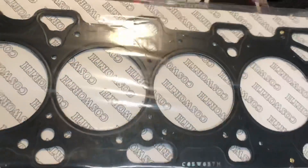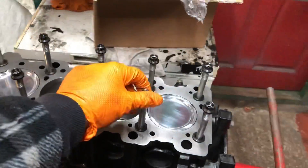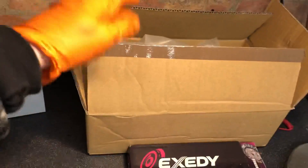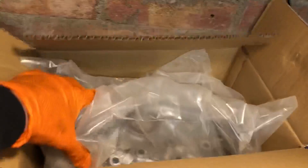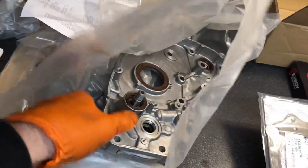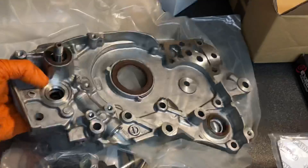This is a five-layer gasket as well, so it's going to clamp down really nicely with these H11 head studs — we're going to have no problem with lifting the head at higher boost. Also, because it's a new build and we don't know how old the oil pump was, we went to Mitsubishi and got a genuine brand-new oil pump. That means we know we're going to have the oil pressures we need with no issues — as you know from the last engine, oil pressure is one of the most important parts.